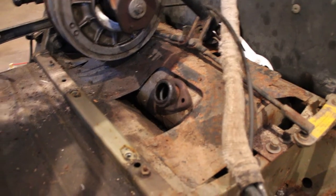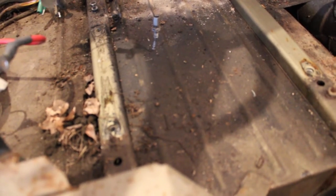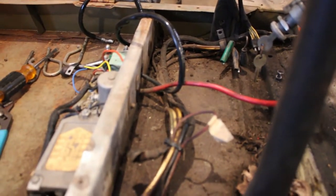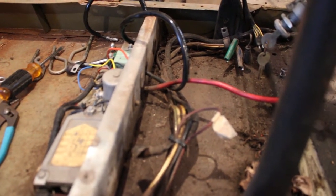Other than that, she's just dirty as hell. I've got to go through here and clean all this up, vacuum it out and everything. I was also missing the air box when I got it. In winter it's not really a problem because there's no dust floating around — that's the same reason snowblowers don't have air filters. But the carb sits right here, so with all this debris in here, might as well get it out before the carb sucks it up and ruins the engine.